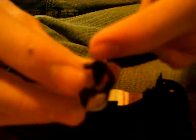And then also, to get this back in, in my other video I show you how to take it out. There's the big side, like the big cut-in, and there's a small little cut. You want to put the small cut on the bottom, the big one on top. Make sure it's the clear side going in first, the other side won't go in first. Just a little heads up. And then you simply just push it back in and make sure you click it in.